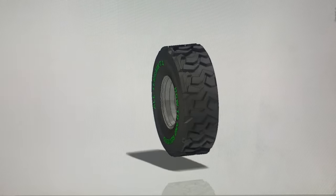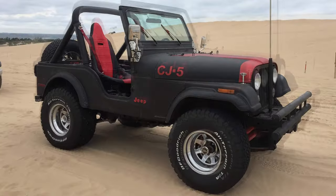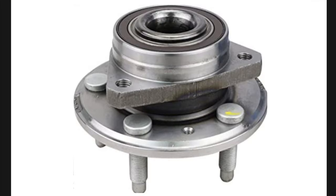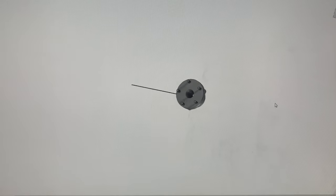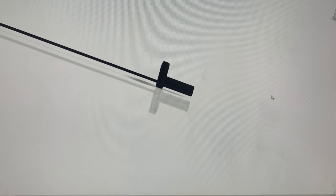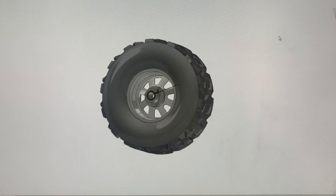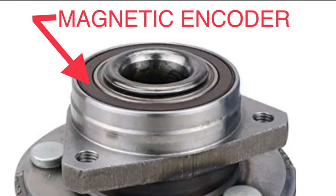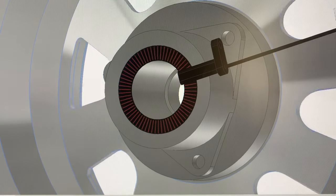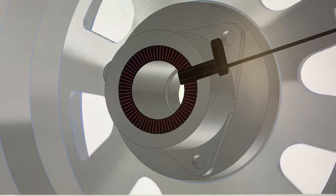Here's an animation to show how the wheel speed sensor functions. Note, this is not an Impala wheel, but I already had it drawn up in CAD, so we'll use it for convenience. I have roughly fitted it with a representation of an Impala wheel bearing and sensor. For simplicity, there are no brake components shown — just the wheel, the wheel bearing, and the speed sensor. As the wheel rotates, the inner race of the wheel bearing rotates with it. On the back side of the wheel bearing is a magnetic encoder ring with radial lines, which rotates with the wheel. The stationary sensor monitors the passing radial lines on the magnetic encoder ring, and as the wheel rotates, the sensor — measuring the number of lines that pass over a period of time — allows the system to know the speed of each wheel.